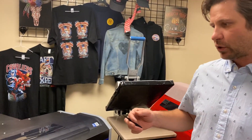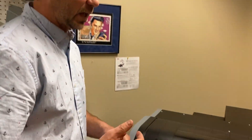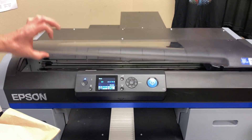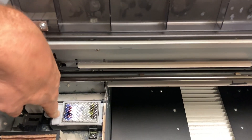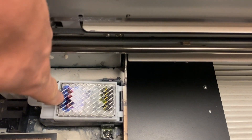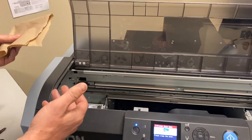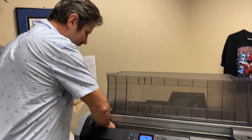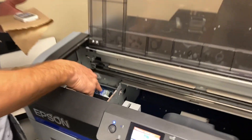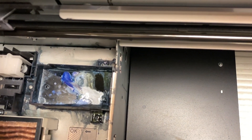This is another piece I want to show you — this is my indicator of when my head cap needs to be cleaned. It's going to spit a little bit of ink. This filter here is your spit tray filter. You can notice just barely that some blue ink is starting to build up there. When this starts to puddle up or become really saturated with ink, it's not draining through the filter anymore and it needs to be rinsed. So what I do is pop this out, put it on a piece of paper right away, take it over to the sink, and rinse it out really well. Once you see water start flowing through it, you know the filter is clean.